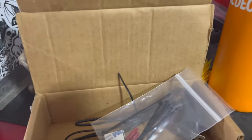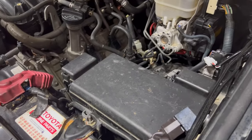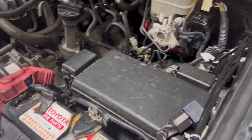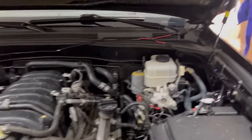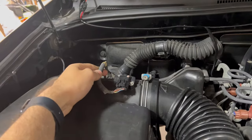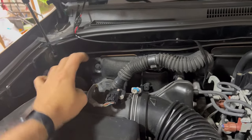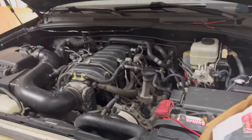I've kind of read through the instructions and looked at a few videos. Pretty much the premise is we're going to open up the fuse box, find the purple relay, put some wires back to the prongs, wire that around the top probably in line with my ditch lights. There's going to be a wire and we are going to use that wire to splice into the new relay. Should only take 10 minutes.